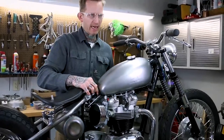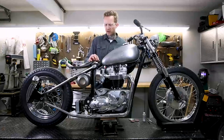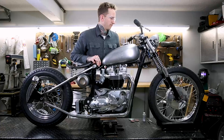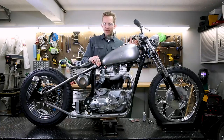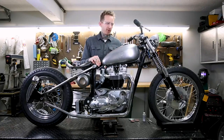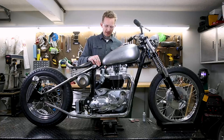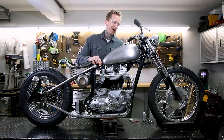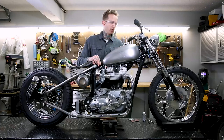The banana tanks, like many of our gas tanks, have slotted holes in the tabs. That makes it a lot easier when you're mounting because it gives you a little room for error. If you change your mind and want to move your tank up a little, it gives you adjustability. Even if you think you have it where you want it, maybe when you're running your fuel lines it's too tight — you can loosen the bolts, slide your tank up that quarter of an inch, and it can make a huge difference.